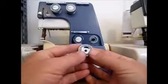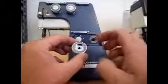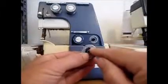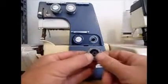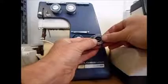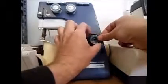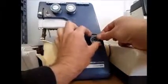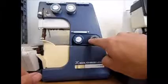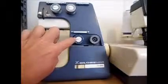When you put a dial back, you've got to put it in a certain position. You'll see there's a number 0, 3, 6 and 9. There are two dots to the left of your 0, and you keep the second dot on the left-hand side of your 0 straight up, push it straight in, turn it to your right, and it will clip in. Turn it all the way in, and your 9 will be just up from the dot. Where you have your little line, you can see your 9 is just sitting there.